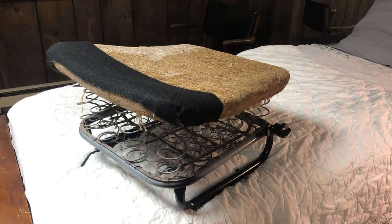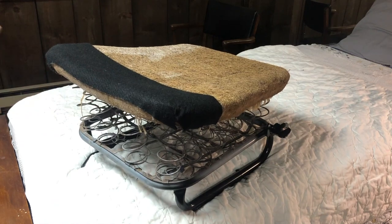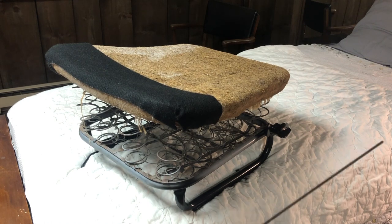Alright, so from what I've seen about doing the seat bottom, you're going to want to do it upside down, meaning you have the seat cover and you put the seat frame into it. Now my cover's been in the dryer for about 3 minutes, so I'm going to give it a couple more, but the seat bottoms also have a metal rod, and like I said earlier, some metal wire. And you want to use the metal wire because the TMI seats do not come with it, and the way Volkswagen designed these seats, where it hooks, if you don't have something there, the hook is just going to pull right through. So you need to do something, which is why I've got the wire.